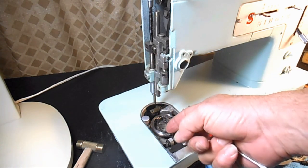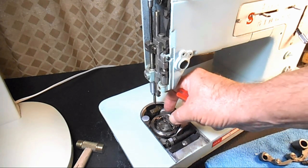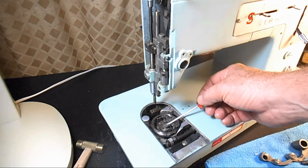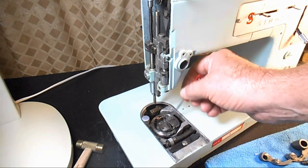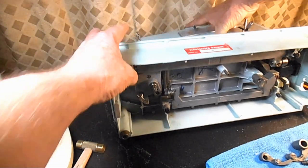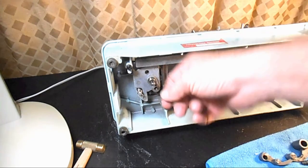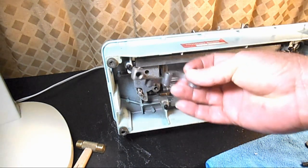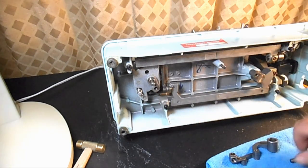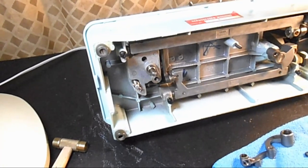The hook is not damaged, so there's really no reason to remove all of this and take the hook out and then go through all of the adjustments to get it back to factory specs up here, unless this whole system was damaged or your hook point was bent or something like that. So by taking the bell crank assembly and Pitman rod and so forth off of the bottom here, we can get cleaning fluid from the bottom up and from the top down, and we can clean all of these other parts and check their functionality, get rid of the corrosion on that big hinge screw and clean it up. Then I'll just kind of semi reassemble it for you in case that's your goal of watching the video right now.